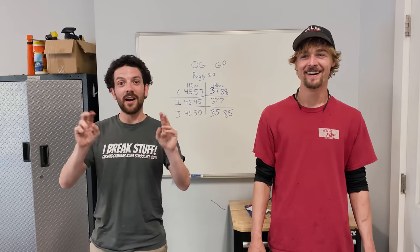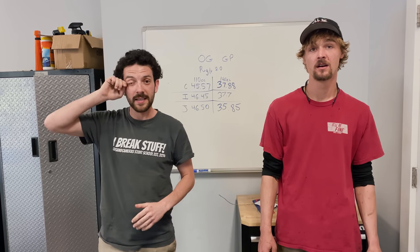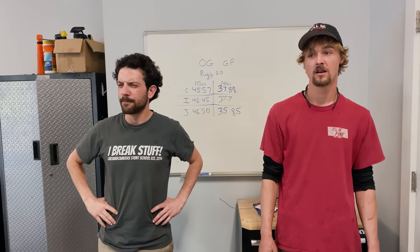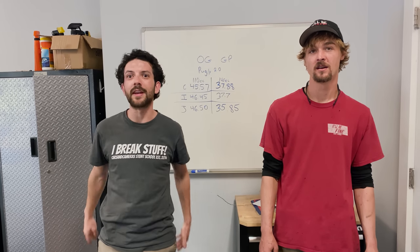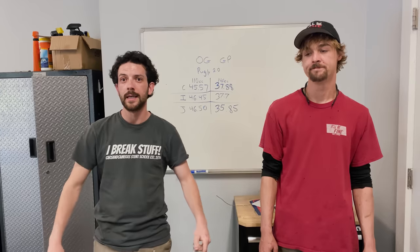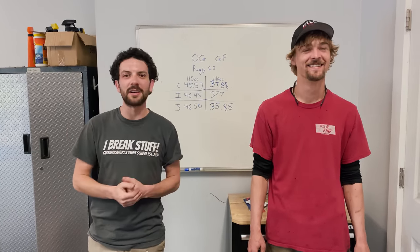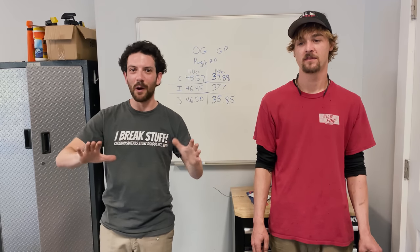I just want to say, driving impressions, if you're thinking about doing a big engine on one of those Chinese pit bike style go-karts like this one, the steering does not feel good at high speed. It feels like it needs more caster in it. Personally, yeah. It gets really squirrely at high speed. The steering radius is also really bad, so you can't countersteer very much. Other than that, rocket ship, scary fast, just what we wanted.